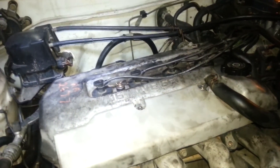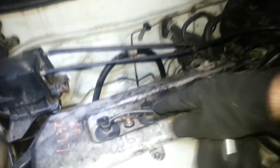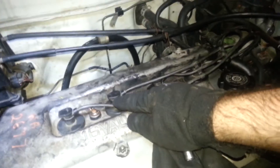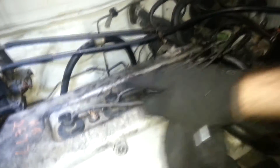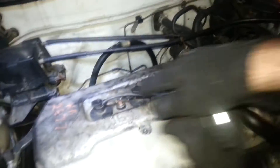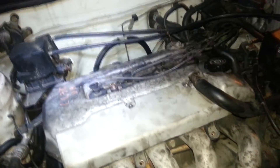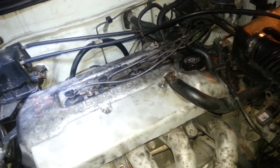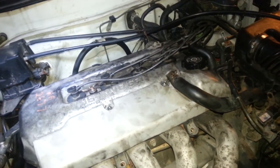When we decided to test his spark plug change, he asked me if the wires were good, so I went ahead and checked the ohms of resistance on each of them. As they went longer, they went from 70 thousand to 100 thousand ohms of resistance, and that's pretty good. If you want to really get technical and make this engine run perfectly — which may not be necessary — iridiums are kind of the stabilizer I've found. You tend to not be able to go wrong. Back in the day of platinums, I adjusted gap all the time.